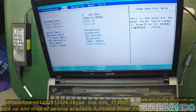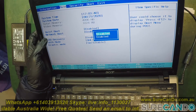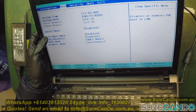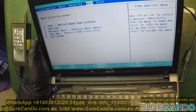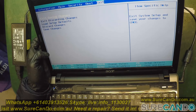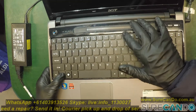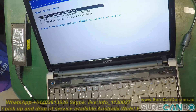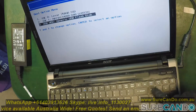Go into the F12 boot menu - you want it to be enabled. Network boot is for corporate use only. Exit and save changes. Then keep tapping F12 or Function+F12 until you get a boot menu pop up on the screen, where you can see your USB flash drive. Press Enter and that will start the Windows 10 setup process.